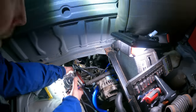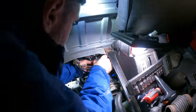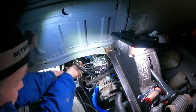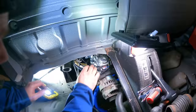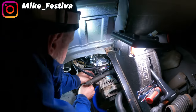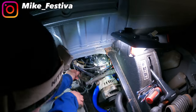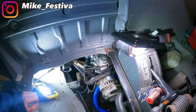Being 30 years old, this truck has had a lot of people tinkering with it and messing up the choke circuit and misplacing vacuum lines. So this new carb is super simple. I only have one vacuum line going to the carburetor, and that's for vacuum advance, one fuel inlet and one for return, choke cable and throttle cable. So it's much easier to take this thing on and off for rejetting.